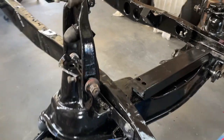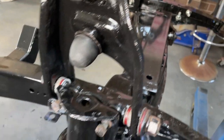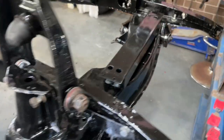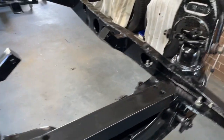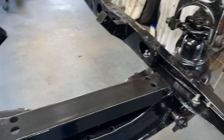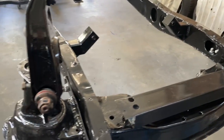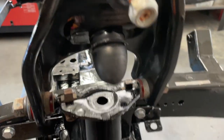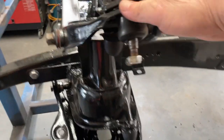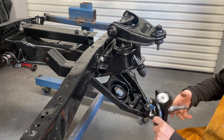What I'm doing now is just putting the top control arms on — they're pretty simple. They just slip over the top of this and they have two bolts that go through here. What I'll make sure to do as well is put these shims back in. Now, they're for your camber and caster adjustment. Although it's probably wrong, I just want them there for the guy that's going to do the wheel alignment so that he's got the shims to get it right. They just sit in there like that, and once that's all bolted up they'll come down and make the stub axle.